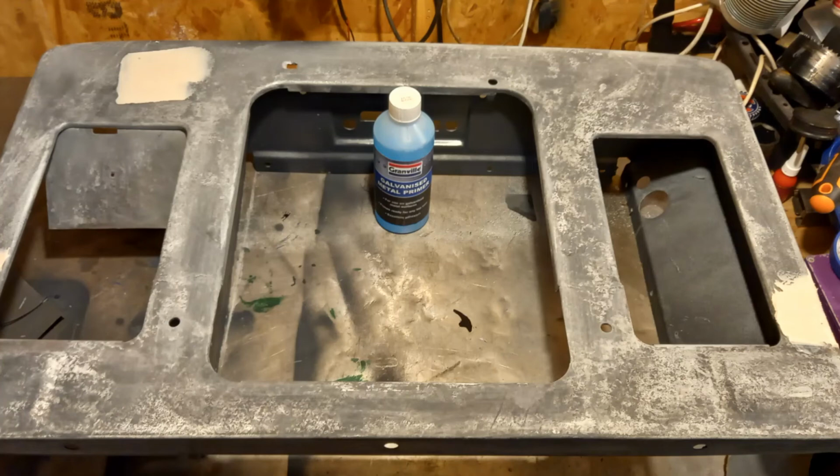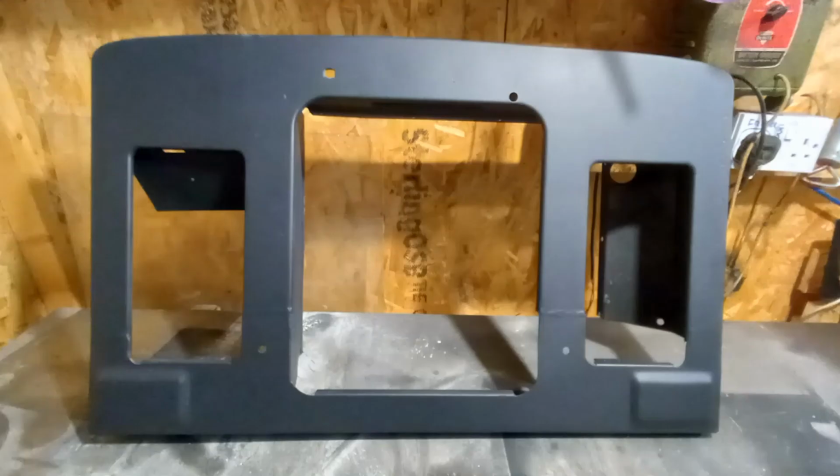So the first thing I did to put this on, I ran around the painted surface, the decorative surface, the front, with some 100 grit, I think it was, in the orbital sander, just to even everything up for paint, so it was flat. Then applied the mordant solution, applied the body filler afterwards. Then I'll just buff up the body filler to put that to shape, and then applied some etch primer. But you really must use that mordant solution, otherwise anything you put onto it will simply fall off again.